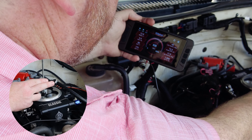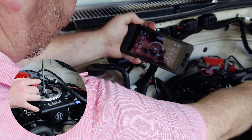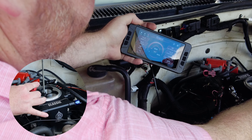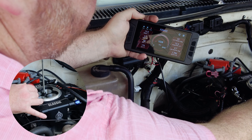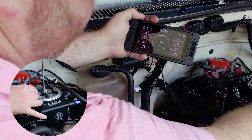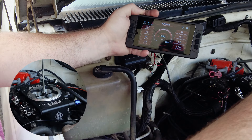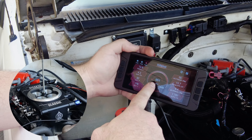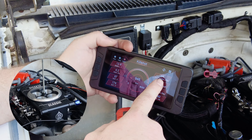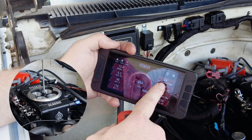A little bit at a time — we've made contact with it and we see the linkage just moves barely. We'll give it a little bit and wait for the idle to come back down. I gave it probably a half turn in at this point, and you can see it idled up right here — the IAC position is now at 34.